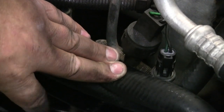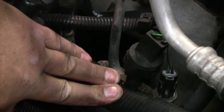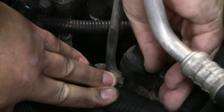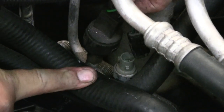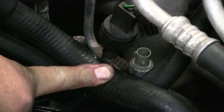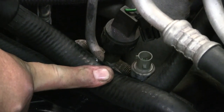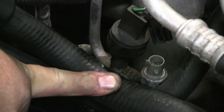Now here's a tip for you. If you do happen to get caught on the road and your engine is overheating, you can go in and disconnect this switch. When you do, your cooling fan will stay on all the time and possibly get you out of an overheat situation, because the cooling fan will run the whole time.